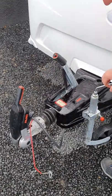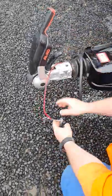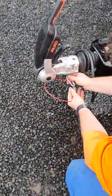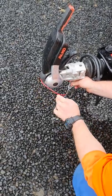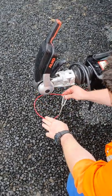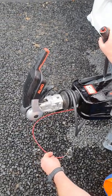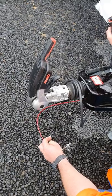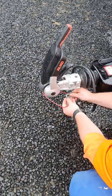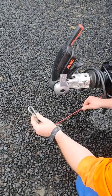You also have in the front here your main trailer plug. You've also got this — this is a breakaway cable. They're designed so they can come around your tow ball and hook back onto themselves with the little carabiner there. They're designed so that in the unlikely event this ever came off, this cord gets pulled and it activates your handbrake — it just stops the van rolling down the motorway past you. Once that's on there, that's all good to go. You can also put this on a de-shackle point as well — it's just personal preference, either way works fine.